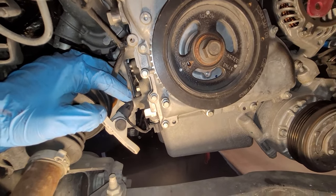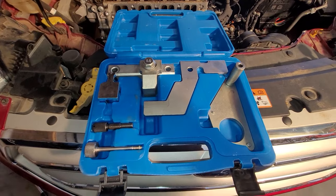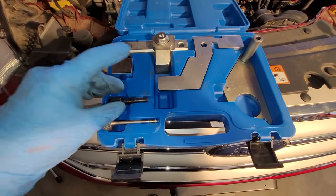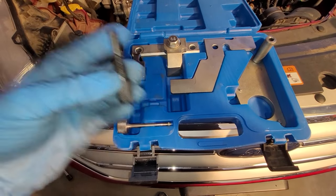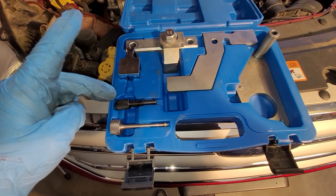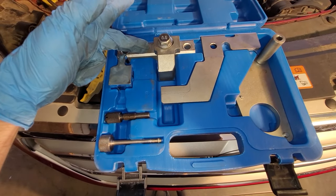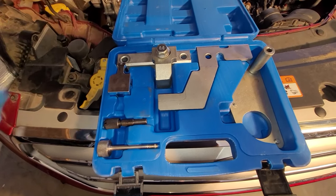Before I go any further, before I forget, I'm going to go ahead and drain the oil in this thing. And while the oil is draining, I'm going to talk about a timing kit you're going to need. I'm going to link this exact one down in the description below. I recommend this one because the tool we're about ready to use is actually metal. Some of these come with a plastic one of these. No bueno, I don't like that. But anyway, this is going to tell us when the piston's at top dead center for timing. And then this piece is going to lock the flywheel once we remove the starter, and we'll be getting to that shortly. But anyway, a link to this is going to be down in the description below.